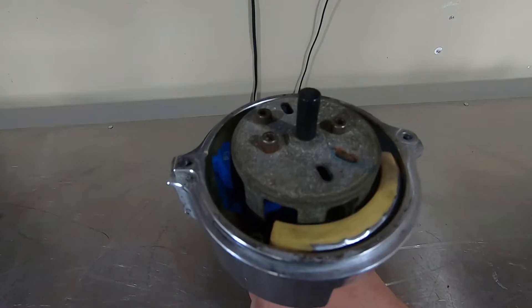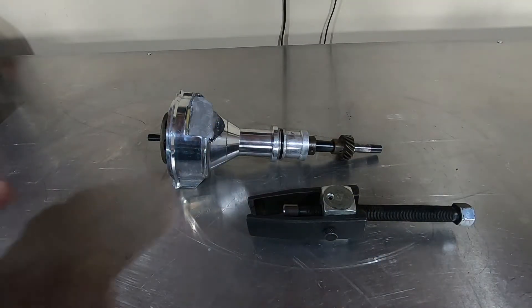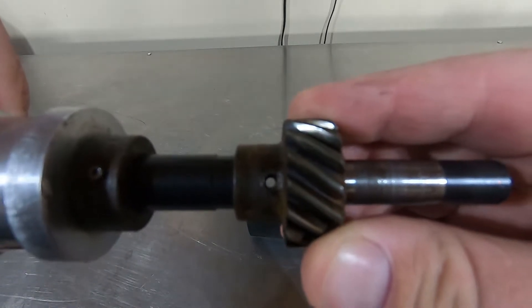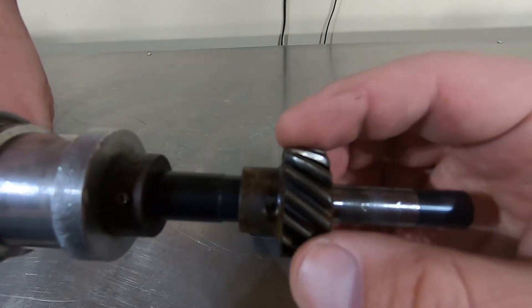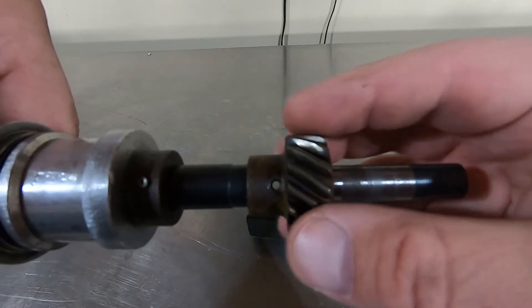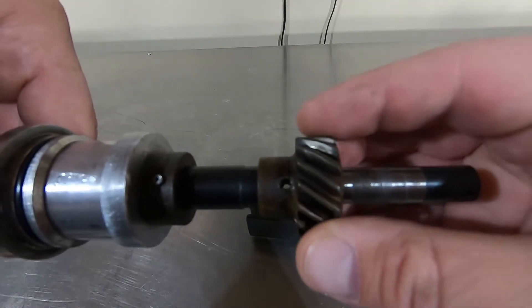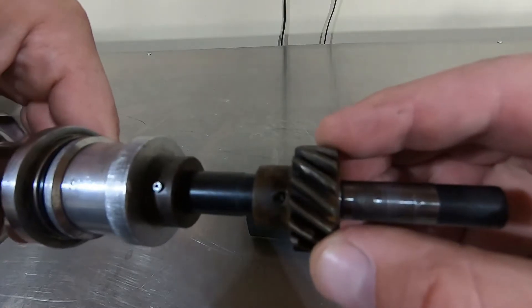I always replace the pickup — I actually replaced the one in this distributor, but I'm going to remove it since I'm not going to use this one. The first thing we're going to do is remove the roll pin, which I just did. Any distributor is going to have a roll pin in the gear collar portion. Just get a good set of steel punches and knock the roll pin out. Once the roll pin is out, you can remove the gear. These are pressed on pretty tightly from the factory. Going back on, you can use the same press fit or take a flapper wheel and hone them out just a little to relieve some of the press fit, though it's always good to maintain the press fit.